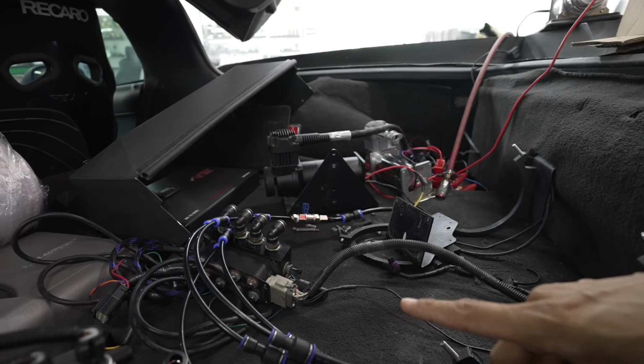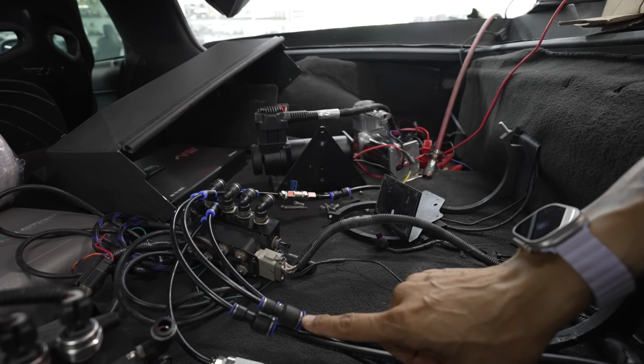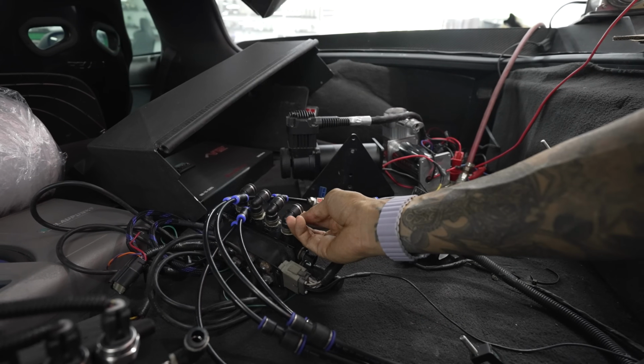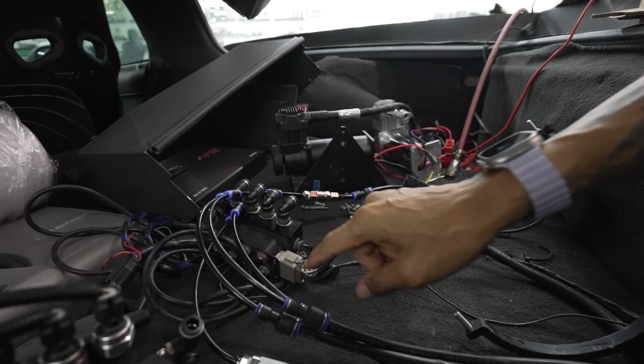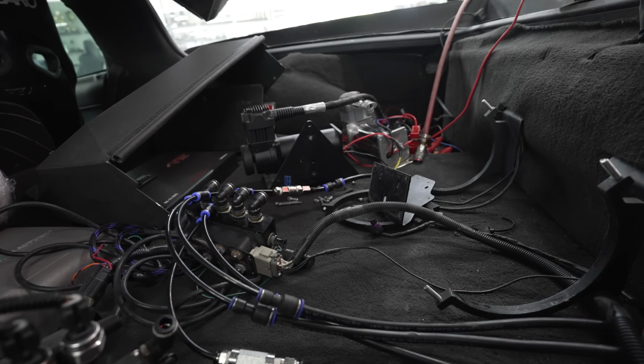But what's happening now basically is these fittings are called Festo. They're color blue and they don't hold pressure that good. So back in Car Porn we used to use these gray fittings. These are meant for air suspension and they're rated for high pressure, about 100 to 150 psi, versus the Festo fittings I think are only like 100 psi, just not holding so well.